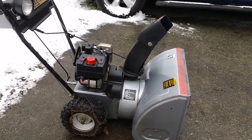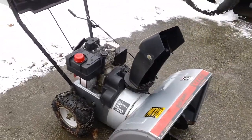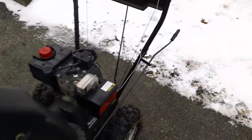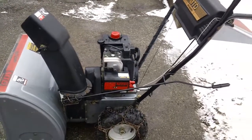The next thing was, the carburetor was completely shot, basically. It was completely dark brown, almost black on the majority of the components — the bowl, the emulsion tube, stuff like that. So we had to do a complete carb overhaul R&R for that.